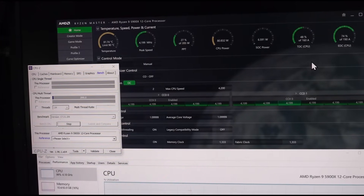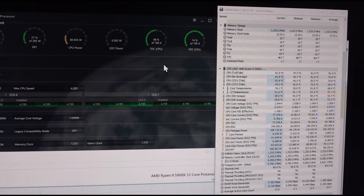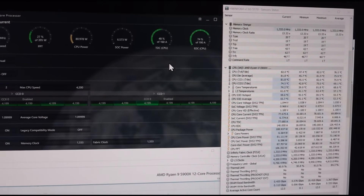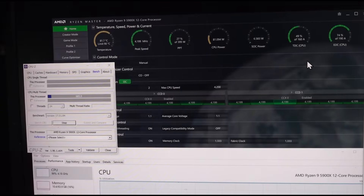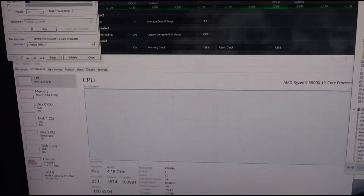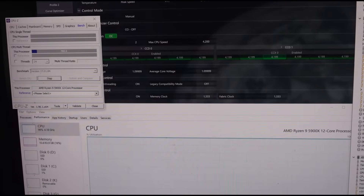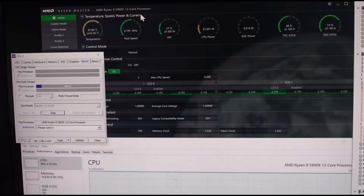The limit is 90 degrees, but 81.6 is getting uncomfortably high. It could be a power supply issue — the PSU could be aging — but I want to solve the thermal problems first before looking into that. The CPU is absolutely maxed at 100%. This is the Ryzen 9 5900X 12-core processor — a bit of a beast.